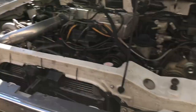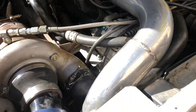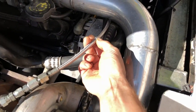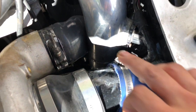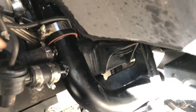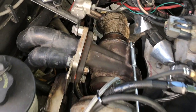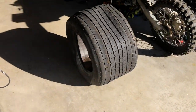Finished up installing the hardware on the other side, so it's about to be the first start on this setup. Fired it up earlier with the passenger side installed, had to add a union to get a long enough oil feed, and accidentally kinked this line - it's pinched pretty bad in between the charge pipe and the compressor outlet. I updated all this to two and a half inch and have two bypass valves now to help with surge. Couldn't get the turbo blankets on there anymore, but I did wrap that downpipe a little better. All that's left after this is tuning.